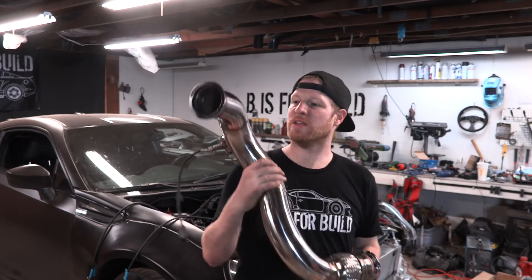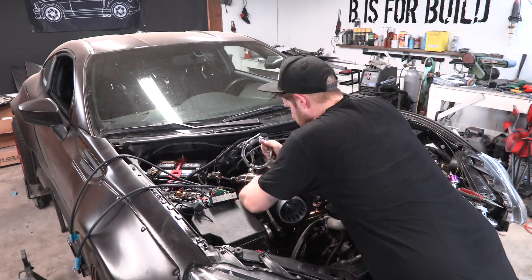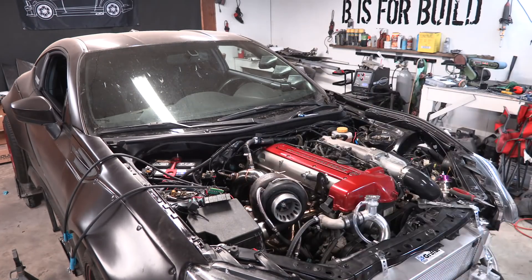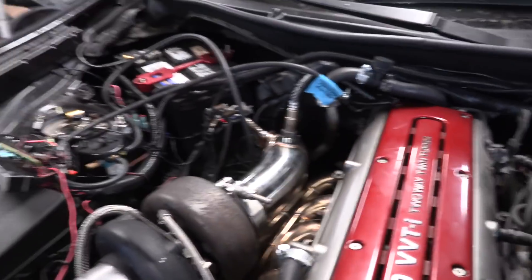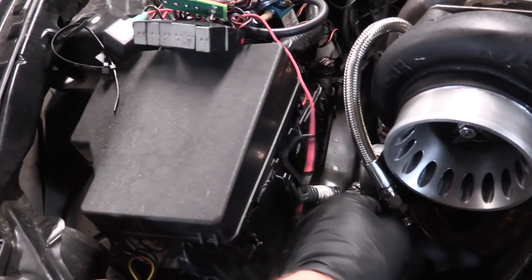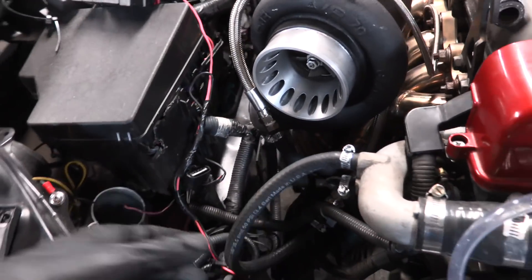This is an awesome stainless steel downpipe that we're going to throw in there to the midpipe that's going further back to our existing exhaust. Huge thanks to CX Racing — they make a lot of awesome swap parts and racing parts. If you want to check them out and see what they have for your vehicle, hit the link in the description. They might inspire you to do something silly like this — that's actually where I got the idea, because once I found out they had a swap kit I was like, it can't be that hard, right? So I think I've got to feed this in from the bottom — it'll bolt onto the back of the turbo. And up here, we're going to put our mass airflow sensor and filter in here.